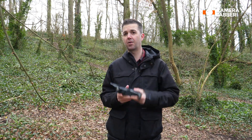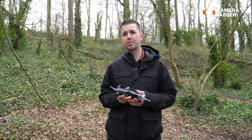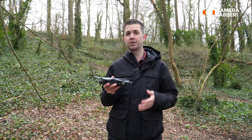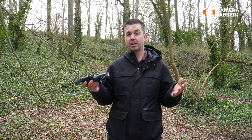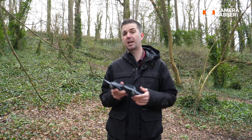This happened to me with this Mavic Air right here, and after speaking to support at DJI, there are a number of things that can cause this error message. If you're in a restricted area, or if there are cables overhead or underground, this can cause interference, so can your smartphone if it's not in airplane mode. Chances are, though, there's a much simpler reason for why this is happening.